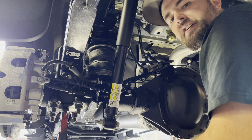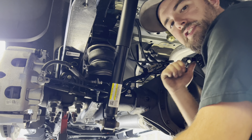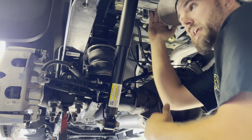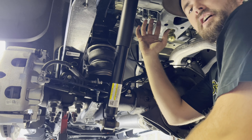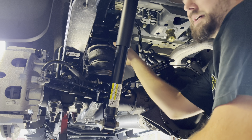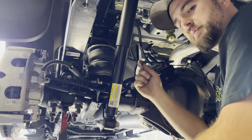Now that we have everything about where we need it, go ahead and reinstall the factory brake line onto the lower airbag bracket. They supply smaller bolts in the kit because the factory one is too long and will interfere. It's still a 13mm - start it in by hand and run it in. That's my favorite part about this kit - it allows everything to go back in its factory location. Make sure that bottom wire goes behind the rear carriage bolt for the most relaxed routing. Now install the passenger side the same way while the suspension is still relaxed, then we'll bring the truck back down on top of the airbag to allow us to put the top hardware on.